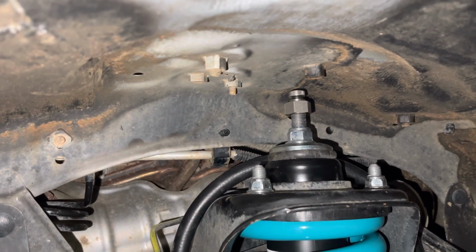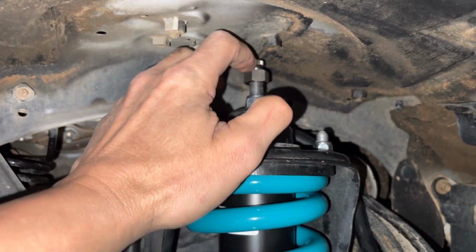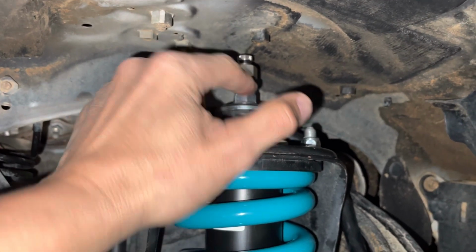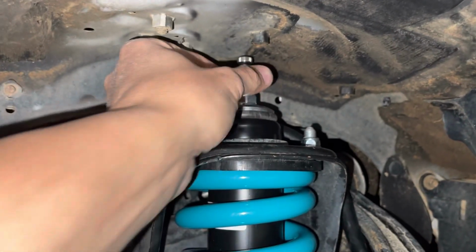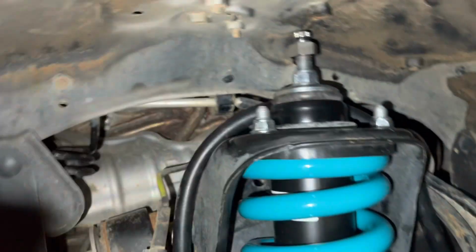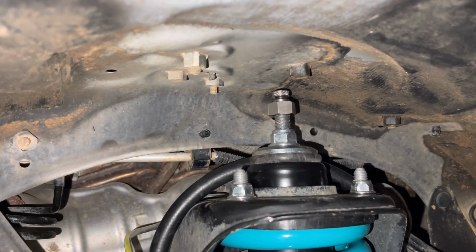That is your Rebound adjustment nut. And there is a spare spring and ball bearing for the pin that sits inside the very end of this shaft. And again, if you get yours already installed, you're just going to be ready to put this on once you get it on the vehicle. Anyway, so you just play around with that. But that is a little hex pin that's inside there, inside that nut. And that's actually what you're turning. So that's your adjustment for Rebound.